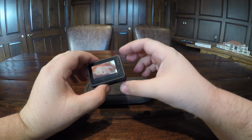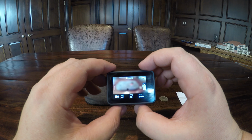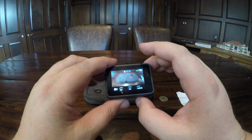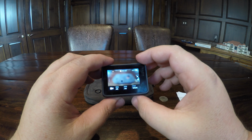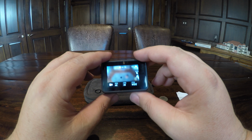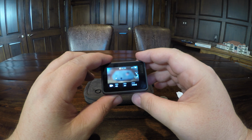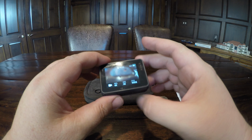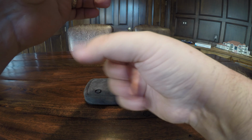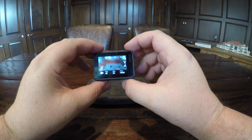These other lenses, it doesn't take me too long to get them dialed in and powered up. You can see I got a little dust bunny on that sensor. I think it's from that plastic adapter. Anyway, those of you with the DSLRs, we're used to dust bunnies. You just get your little puffer, rocket, whatever, pull the lens out and pump some air in there and blow that out.